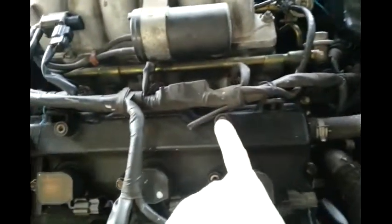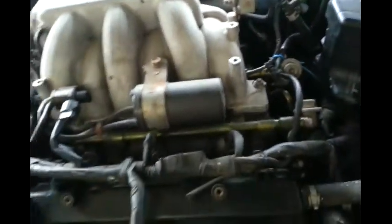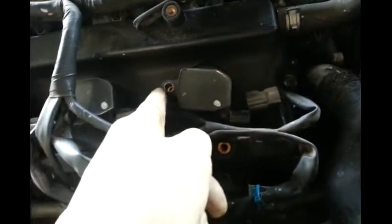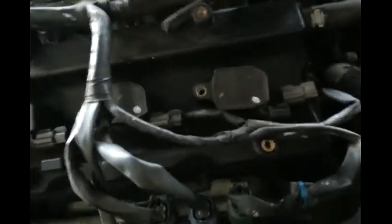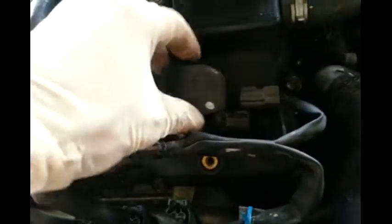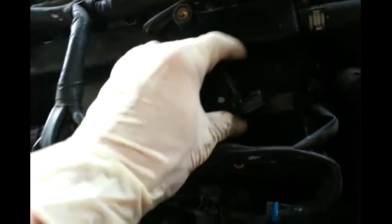So I remove the engine cover with four Allen wrench bolts. This right here - by the way, this is number 6 here, I looked it up. So just using a number 10 socket, I remove the bolt here. Here's the bolt, number 10. And unplug that, and I take out - you see the coil here. You see number 6.